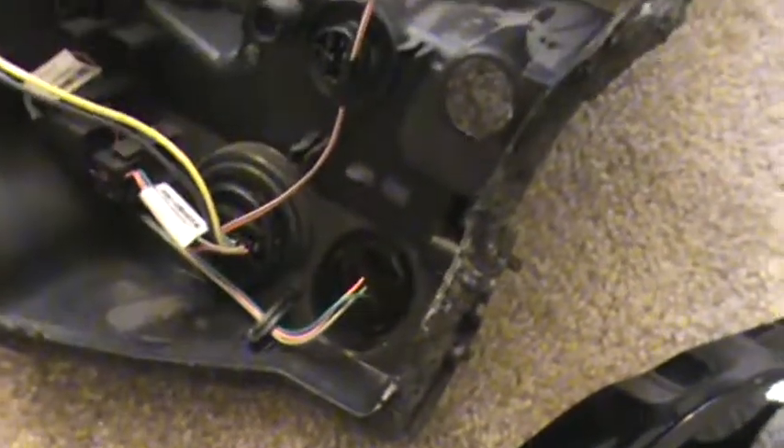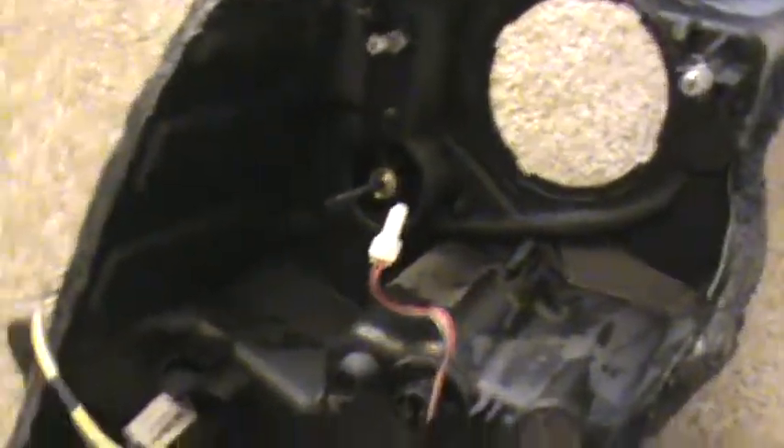As you can see, I've got the headlight opened. I went across first with my hot knife, which didn't cut deep enough to the permaseal. Then I took out my Dremel with the cutting blade and ran that across the edge, which did do the job. So it probably took twice as long as it needed to. I started this at like 10 o'clock in the morning and it's like 4 o'clock in the afternoon. It comes apart into three pieces once you take all the little screws out.